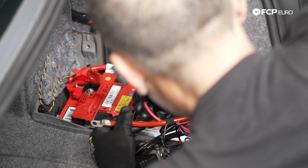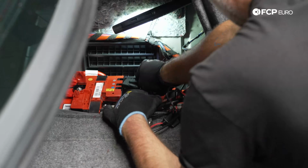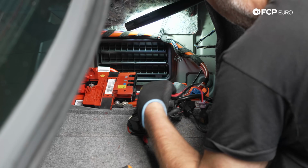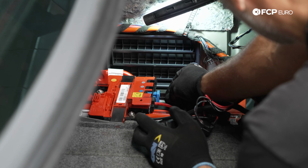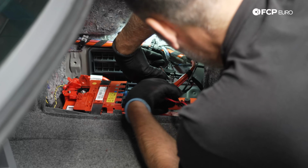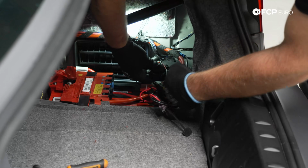So we have this other battery cable here. That's gonna be the other 13 millimeter nut. And then we have these simple click-in connections that we need to do. The blue one goes to the section labeled blue. So that clicks in like so. We are in a position where we can throw our battery ground back on.